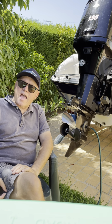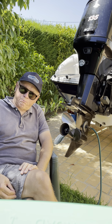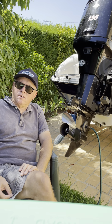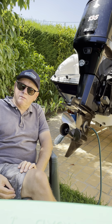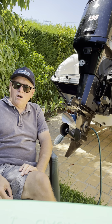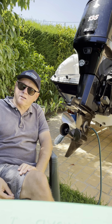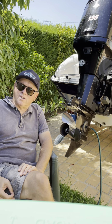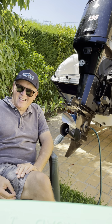And the computer's very smart, and it actually varies the ratio of oil to fuel mix in the engine from about, I think, 44 to 1 at top end speed, flat out, down to about 400 to 1 at idle. So obviously it uses a lot less oil than a traditional two-stroke, which is great, because the Optimax oil is not inexpensive, and I'll sort of get to that.